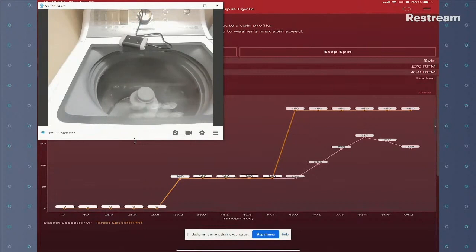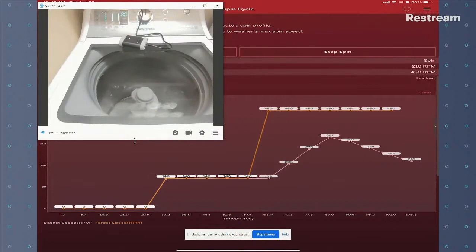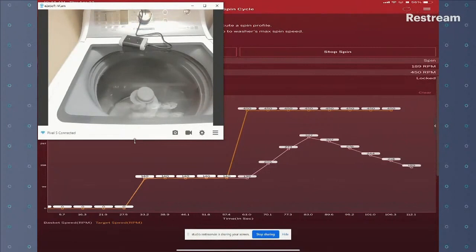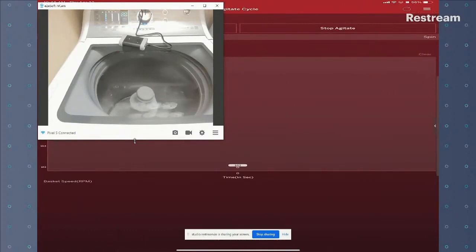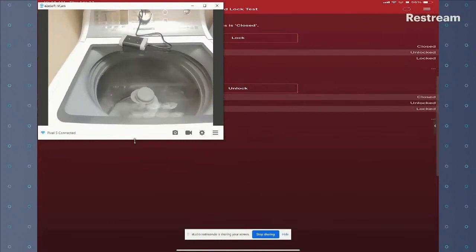This is how you can look at a unit during the spin cycle and see whether the machine is performing as expected — and you can do it all at the tips of your fingers from your mobile app, without having to disassemble the unit. I could also do an agitate test, a lid lock test — the unit won't go into the spin cycle unless the lid is locked, so if you're having problems with the spin cycle it could relate to the lid lock, and being able to test that is useful. That's what I wanted to demo for the washer.